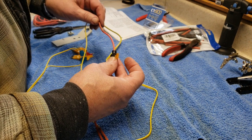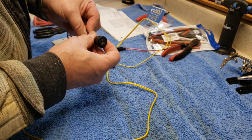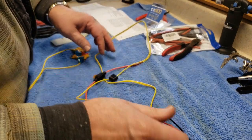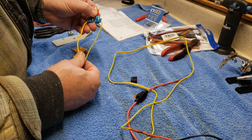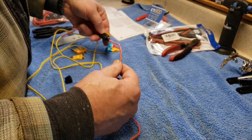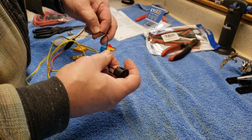I've got the same size fuse as what I'm pulling out. I soldered my two wires and used shrink tape around them to my switch — and there's my switch, on/off, on/off. That'll be hidden somewhere in the car to hopefully slow down anyone who wants to steal it. So that's basically what makes up the switch: a wire, making sure you've tapped into the hot side and marked it, continuing it to your fuse, and then solder and shrink tape the toggle switch. I'm using a two-pin toggle switch with a middle spade connector.